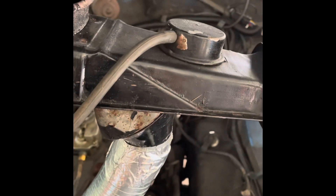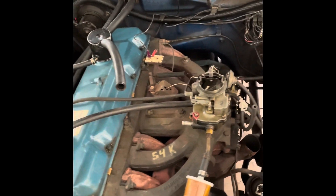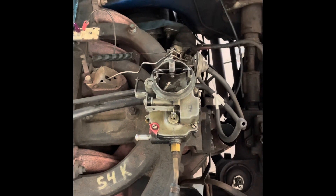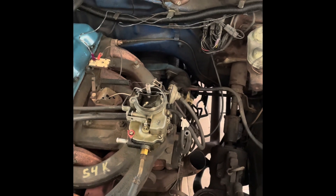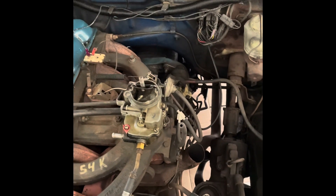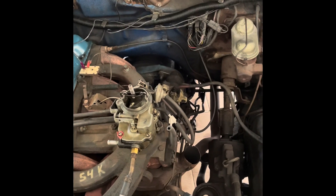I think they call it the thermo vacuum system. Basically, when an engine is starting, it actually wants hot air — and a carburetor kind of wants relatively hot air all the time. It's not like a fuel-injected engine. You need the fuel to vaporize as it goes into the cylinder. Modern fuel injection atomizes the fuel really well; carburetors run at a couple of PSI and don't vaporize fuel very well. Designers had to make sure the engine got relatively warm air coming in at all times. Per the factory service manual, the system was designed to draw in about 95 to 105 degree air at all times.